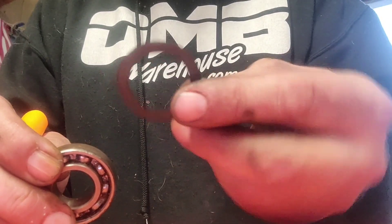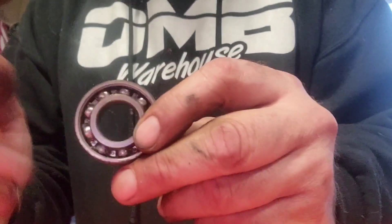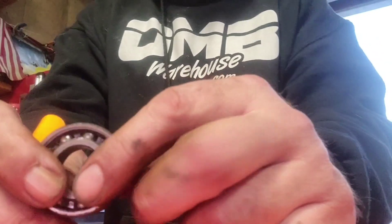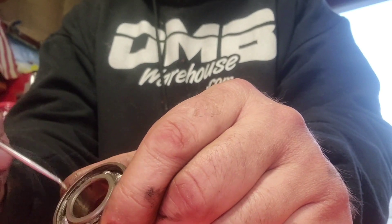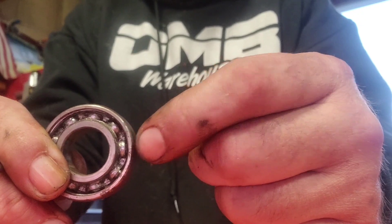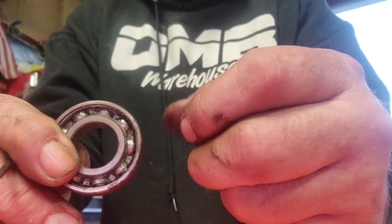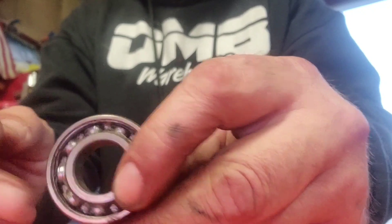We're putting our seals back on. I have some new ones ordered — it's good to have backups. What went wrong with these guys is those inside seals came off somehow. What's gonna happen then is when dirt gets inside that tube, it's now gonna find its way into the bearing. Any fluid that's gotten in there — water, ice, snow, mud — is also gonna carry a particulate like a fine sand, and that will stick to even that broken-down grease. That will eventually break down the balls or the races. This is machined, so we're talking precision.